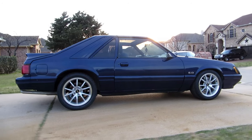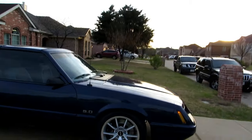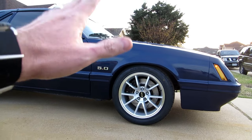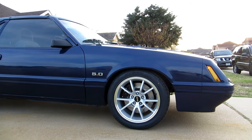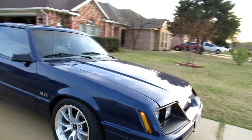The main things I had issues with whenever I first got out on the road was the front end was too low. And the alignment on it was just absolutely terrible. The camber on this guy is still tilting a little bit too much. So that's good, I mean, it's got negative camber. The other side is pretty well even, so I've got to bring this wheel out. It's got plenty of adjustment to come out. See if I can show you here.